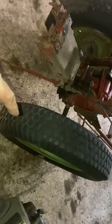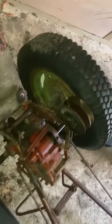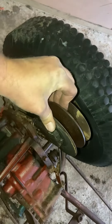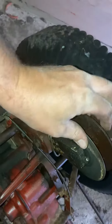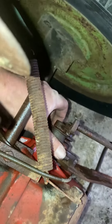Just got some tires put on it. The ones that were on here were pretty well dry rotted and cracked out. So I'm going to run these, see how that goes. Got my speed changer freed up — she's a little stiff still, but she'll slide. My throttle cable was there, so that's free. Got my reverse mechanism, and all that's free down here.